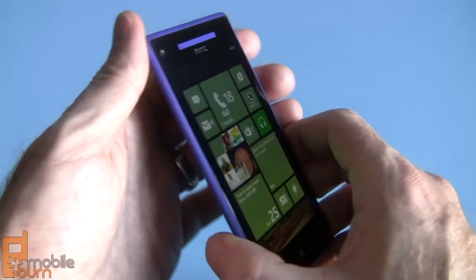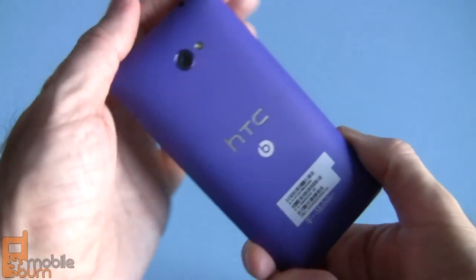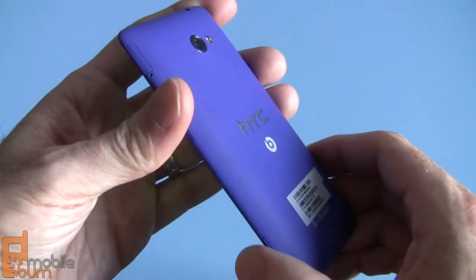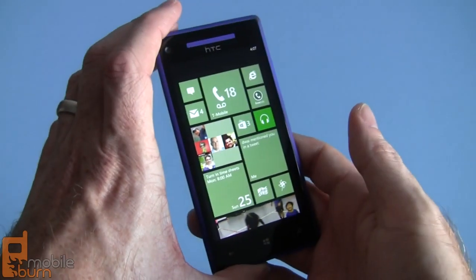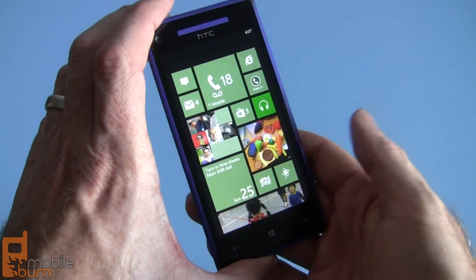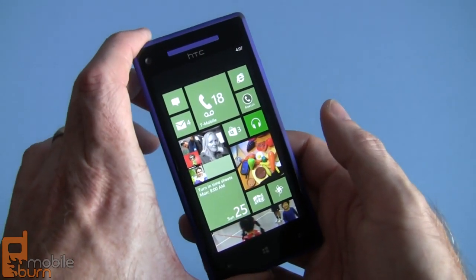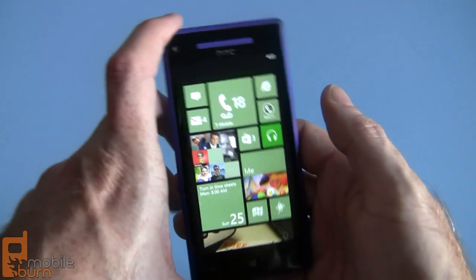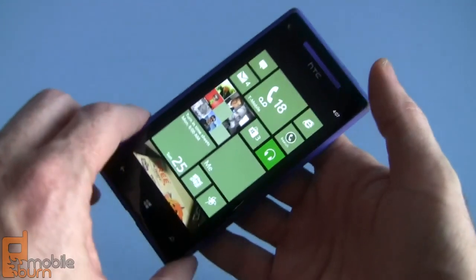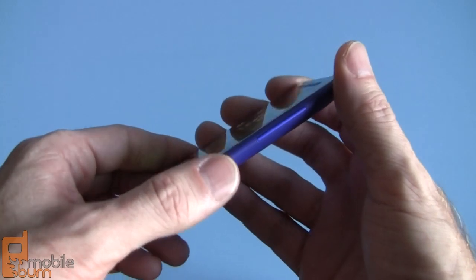In terms of hardware connectivity, it's got 802.11 b/g/n Wi-Fi support, so it can connect to just about anything. It also supports quad-band UMTS at 42 megabits per second 3G/4G data speeds — compatible with the 1700/2100 MHz bands used by T-Mobile USA, and also the 850 and 1900 MHz bands used by AT&T. So if you get the phone unlocked, you can use it on AT&T with absolutely no problem.